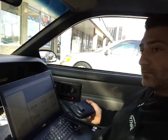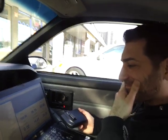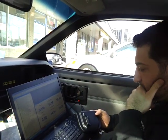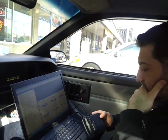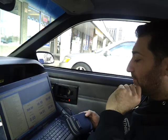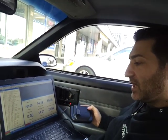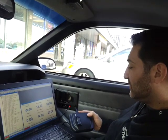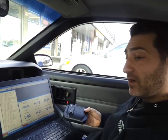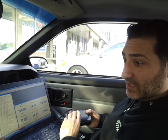Hey guys, George here — my buddy George, master tuner and mechanic. We just finished tuning a chip for this car. So George, run us through what you just did. Basically, we were driving around doing an emulation, which means we change parameters on the actual ECU by flashing it while the car is actually being used, as opposed to having a chip and burning it, removing it, burning it, removing it.